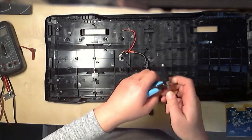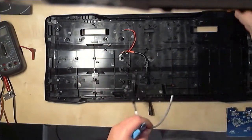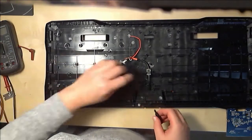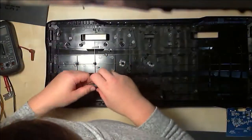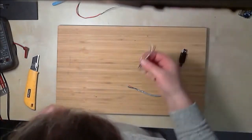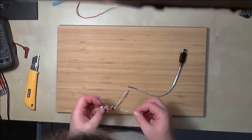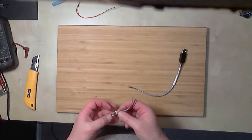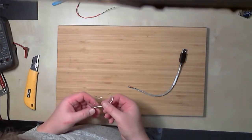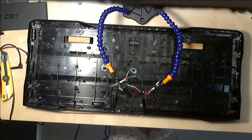I'm going to replace it with just this little USB extension cord. I'm going to snip off the end — and there it goes. I am going to replace that cord with the USB. We're going to lose a little bit of power going in; the second USB just provides power to the hub. But really, you're not going to run anything other than a mouse. This connector connects to that little blue USB hub — it's still color-coded, so it's not going to take a hell of a lot. That little circle thing is a ferrite ring that just helps reduce noise and crosstalk and all that stuff. And there's an additional red wire that grounds out to the support there for the mouse. All I'm going to do is solder these guys up together.